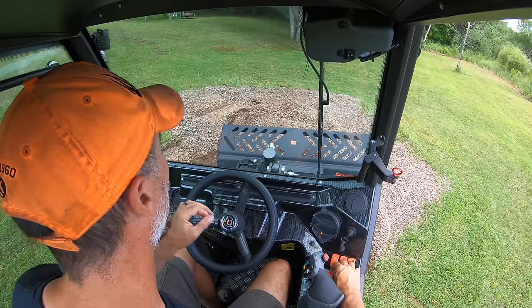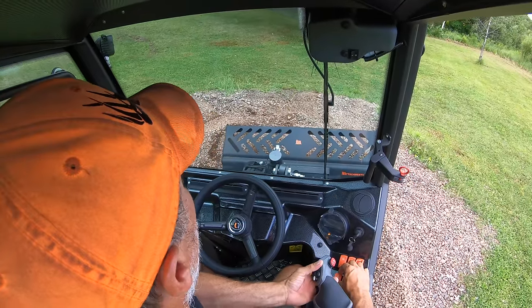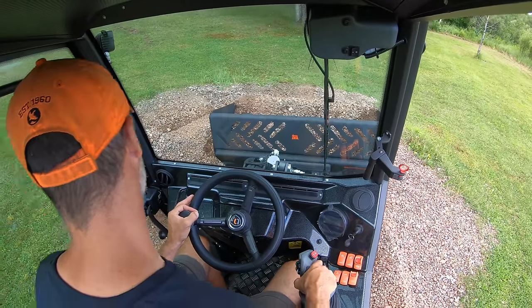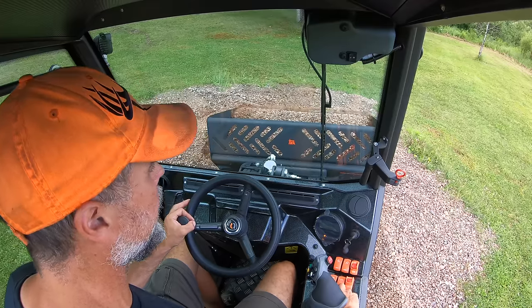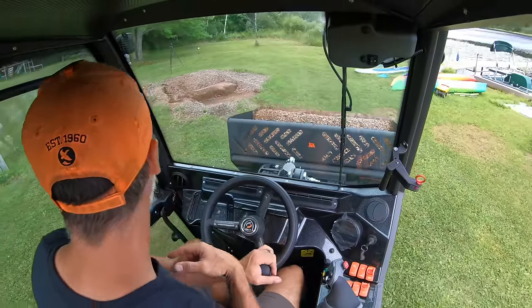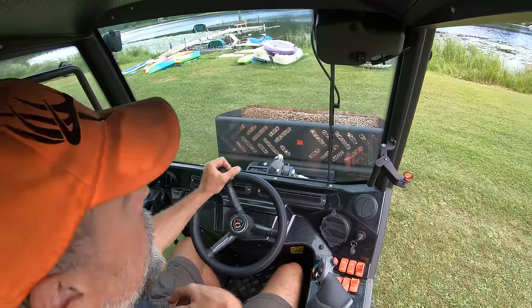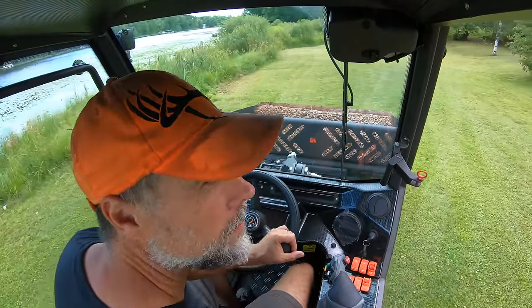As I get into the rocks, I lose traction, which means I've got to lock my diffs out. Now I'm on rocks, so I know I'm going to be stuck. I'm going to lock my diffs and back out. Locking the diffs locks all of the wheels together, so it's recommended you don't turn until you unlock the diffs. But it's just a switch you can flip instantly on or off, right there in the cab.